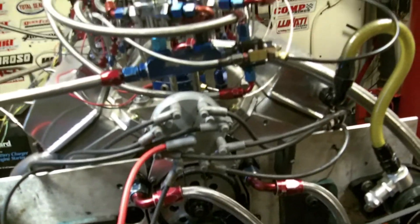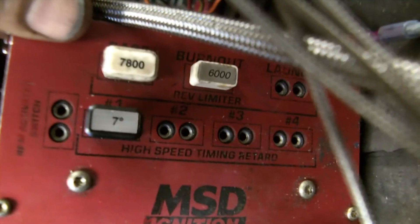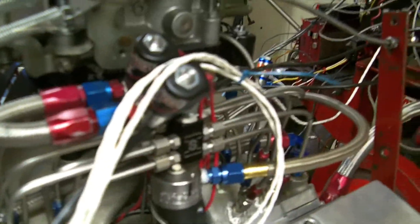We did have our special racing fuel tune-up on it. We were running 37 degrees on the motor total timing because it is a pump gas motor, so we backed the timing down to 35. We're pulling 7 degrees out — as you can see on the head of the spray, we only got a 7-degree retard right there. And it's wired in one wire. This has multiple stages and we do do them, but my dyno's only good for 1,400 horsepower and I don't feel like breaking it. As you can see, it's all plumbed up nice. It's got a 1050 Dominator — it's an animal — and this old girl is going to run 460s with just the two foggers. I don't know what he's going to do with that plate system — he's all by himself there. I can't do it on my dyno.